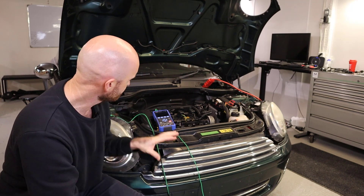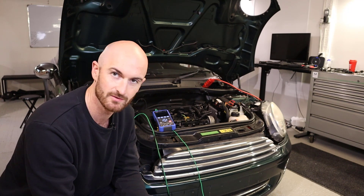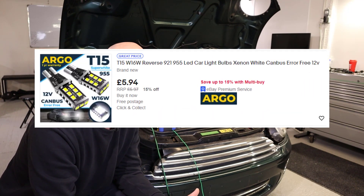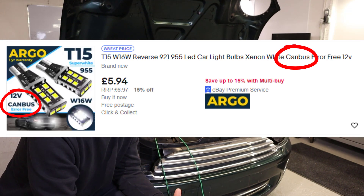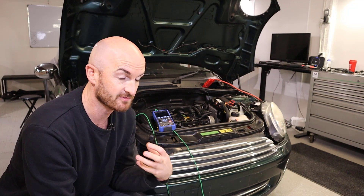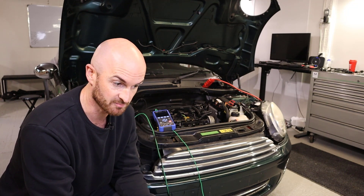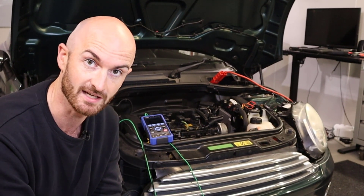It can then just turn that circuit off. So now when you see people with those LEDs in their vehicles flashing away, you know it's actually nothing to do with CANBUS — which is what most aftermarket LED bulb manufacturers advertise their product as being. They say these are CANBUS safe. It's not CANBUS, it's cold bulb monitoring safe.